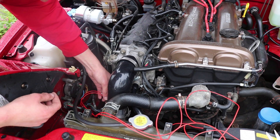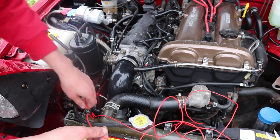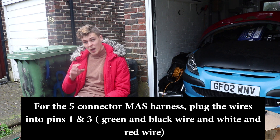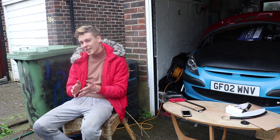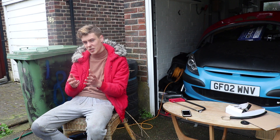Using the wiring harness we made, we plug the IAT sensor straight in and feed the wiring all the way around to the other side of the engine bay. That's the end of today's episode. To give you an overview: we fabricated the rest of the cold-side intercooler piping and attached the IAT sensor and idle control fitting, so now the car knows how to idle and the ECU knows the intake air temperature — essential for a turbo car. For the next episode, it depends what parts arrive first.